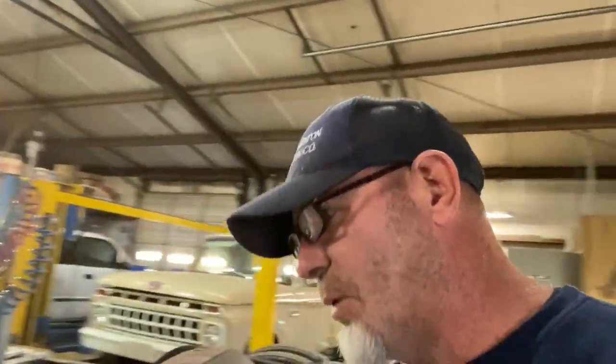As y'all seen from the beginning of the video, the old unit here, old load, found out that it's got a bad carry bearing. So that's what we're going to do today. We're going to change our carry bearing and I'm going to walk y'all through it. That's basically all this video is going to be, how to change out a carry bearing.